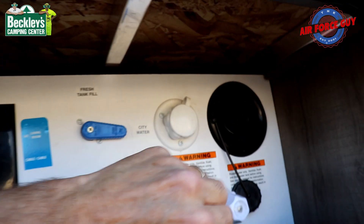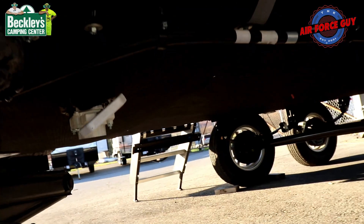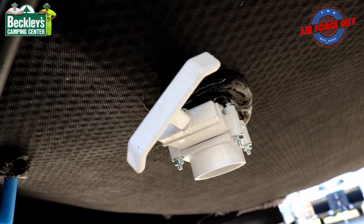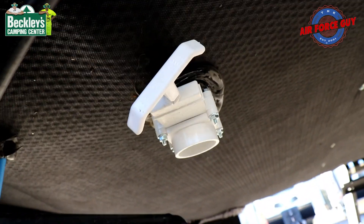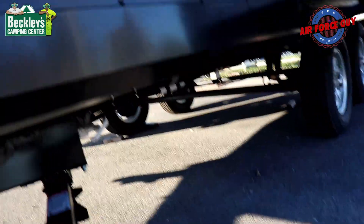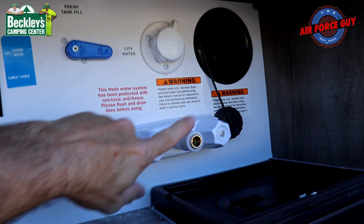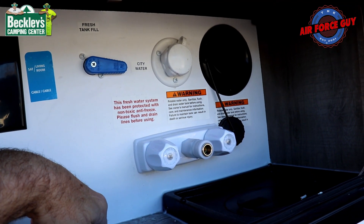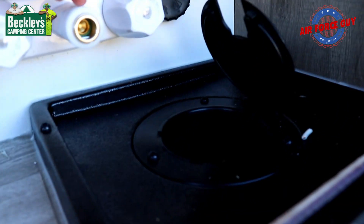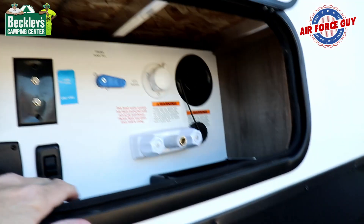You have the manual way of filling your fresh water tank right here, and because the manual fill is right here, that tells you right down under here is where your dump is going to be. It's a nice big tube with the handle making it very easy — you don't have a cap that you need to pull off and worry about putting somewhere, so the fresh water tank dumps much quicker. You also have right here your outside shower with both hot and cold water. Because you're bringing your water hose and cable up through here, I'd recommend putting some brass wool in there to keep the critters from coming in your camper.